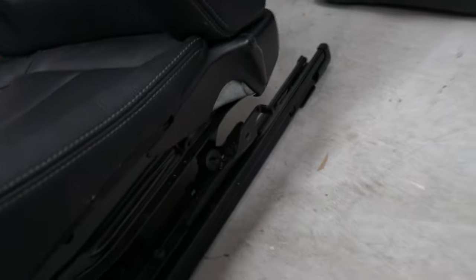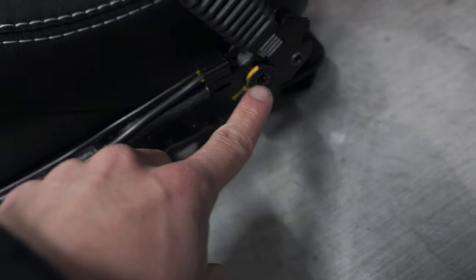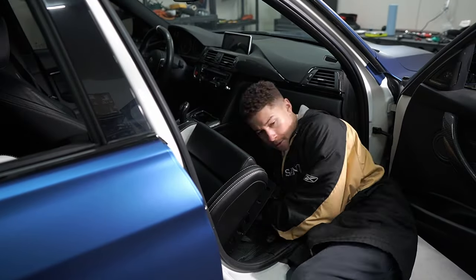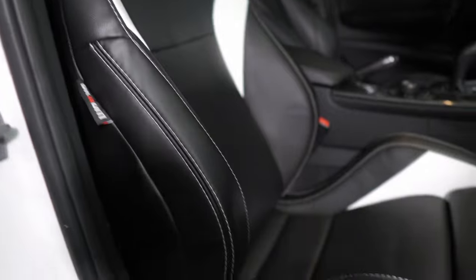Just installed the seat belt to the new seat, so we are using our OEM seat belts. On the sides you can see where it was mounted — you're gonna have to unscrew that bolt and place it on here. Unfortunately Braum did not send out a nut for the back side, so you can either make a Home Depot run, but luckily I had some nuts laying around in the garage. I used the OEM bolt I removed from the seat belt bracket — it's a little ratchet but it works. When you remove the seat belt, just make sure you're removing this harness and taking out this set of wires, then the whole seat belt bracket will come out and you can plug this back into the yellow harness.